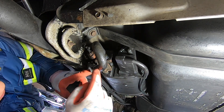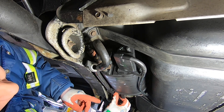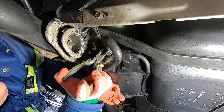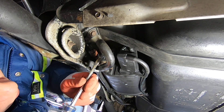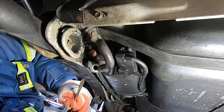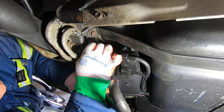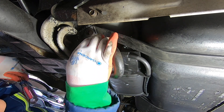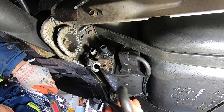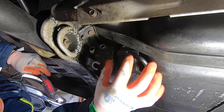There's going to be a series of hoses to disconnect. Starting here with the vent solenoid — take that out by popping it out of the holder and on the back side. Use a pair of pliers and twist the hose back and forth to break that seal. Be careful because on these older cars the hoses are starting to get really hard and brittle, so you may end up having to replace some if they break. Then there's a connector here — you squeeze that. There's a lot of dirt and salt here so it's a little tight. Unclip this vent hose — it's a long one. There's another hose up on top that's actually easier to remove from that metal piece than from inside.